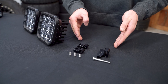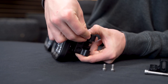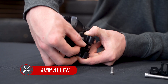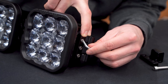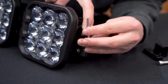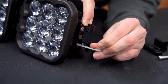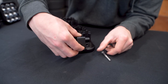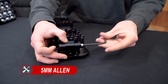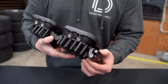There are two parts to our end mount kit. We're going to begin with the curved portion and attach it to the side of our SS5 using the three short 4mm Allen bolts. The second portion of our end mount will attach using our 5mm Allen bolt. You're going to want to keep this loose so you have room for adjustment when installing it on the vehicle.